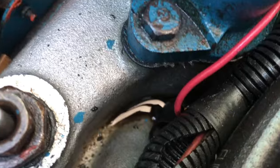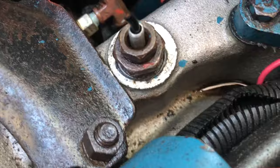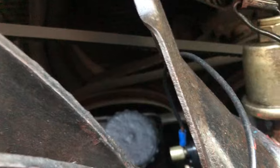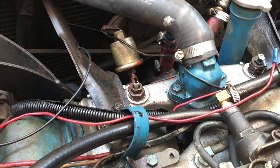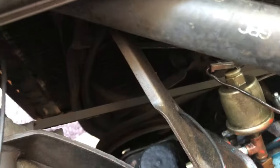If we look down here, we see there's oil in a decent quantity in our intake manifold casting. We're also very oily on all these surfaces here, and it seems like maybe the fan blows back oil. This surface here is very oily. So that's why I was thinking maybe the front main seal was leaking oil and it was just dripping and then blowing back all over everything. So that's the theory, but we're going to have to just start taking stuff off.